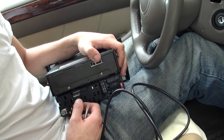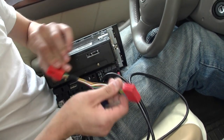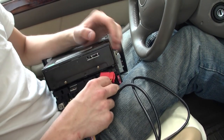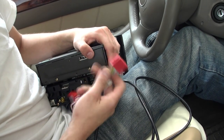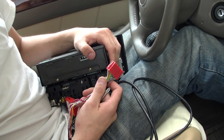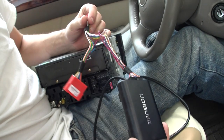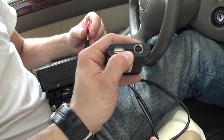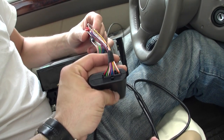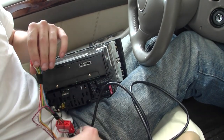We're back in the Audi Allroad. We're going to show you how to install any iPod adapter. This is the Dension Gateway 300 — the GW33AC2 — which is just like the GW16AC2 except it adds USB. The box includes USB, auxiliary, the iPod cable, and the car harness.